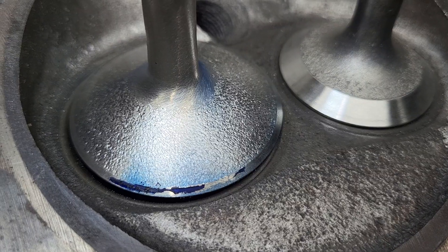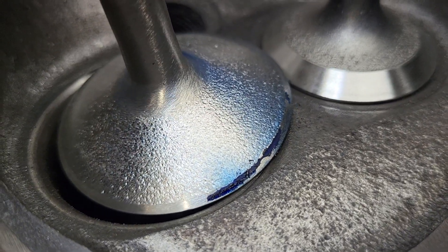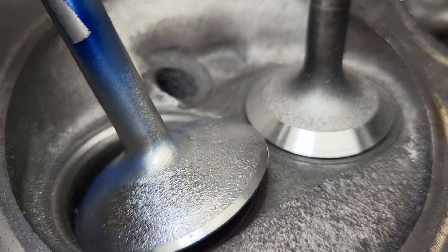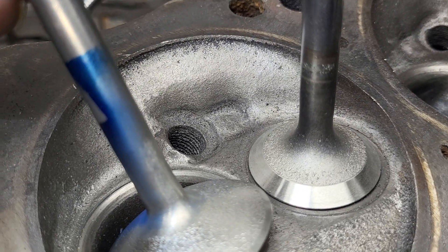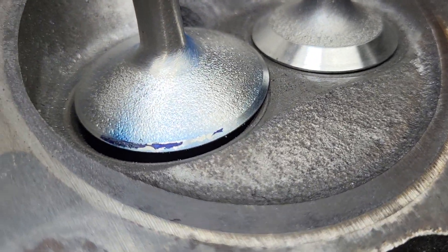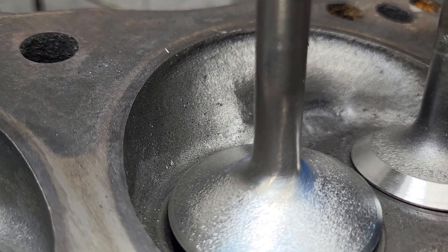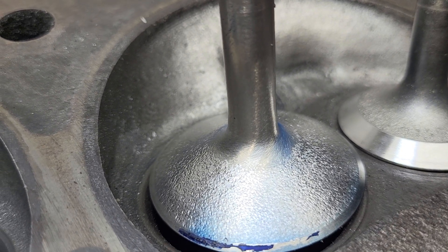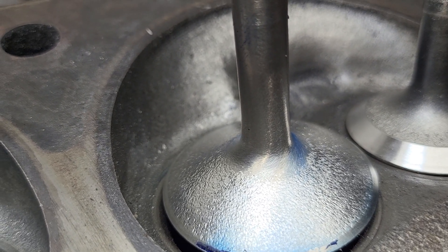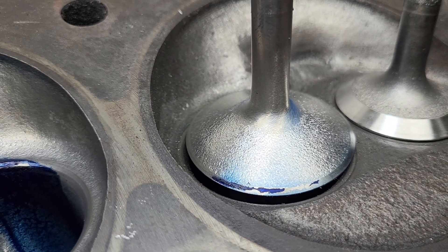It's interesting to think about — we've got much much less powdering on the valve. Much less. Now this was the valve we were using — you can see how much the stem gets hit. Okay, now anyone that wants to apply this experiment to real life: you need to pay attention to the stem. The stem is highly stressed, so you really don't want to be hitting the stem with the burr.